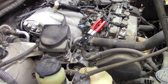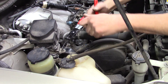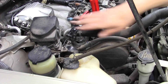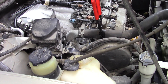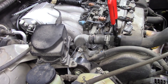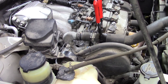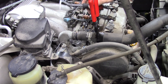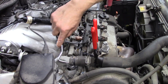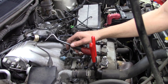The upper radiator hose is in the way — another job for the ring clamp pliers. But since the hose was full of coolant, we'll use hose clamp pliers to clamp it before removal so we don't lose coolant all over the engine. The ring clamp pliers make easy work of the spring clamp. The hose itself is absolutely stuck on there — you could use a radiator pick to break the seal, but that risks poking through the hose, so use those sparingly or only when replacing the hose.